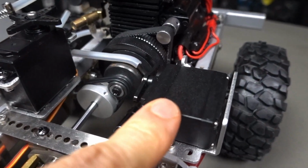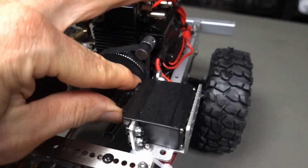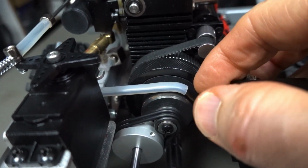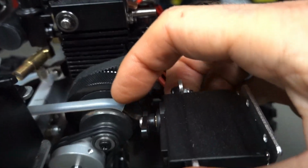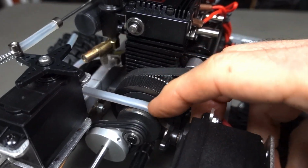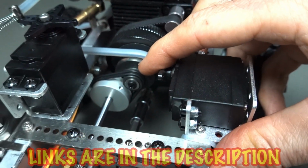And check out this. This is a little bit different. I have never seen this before. So there's your brake, and it pulls down on this little, see this, see that? Kind of like a band style, old school style. So it's got like a metal bar there, and it's wrapped around with a rubber boot, and that rubber boot rubs against the bell housing here.